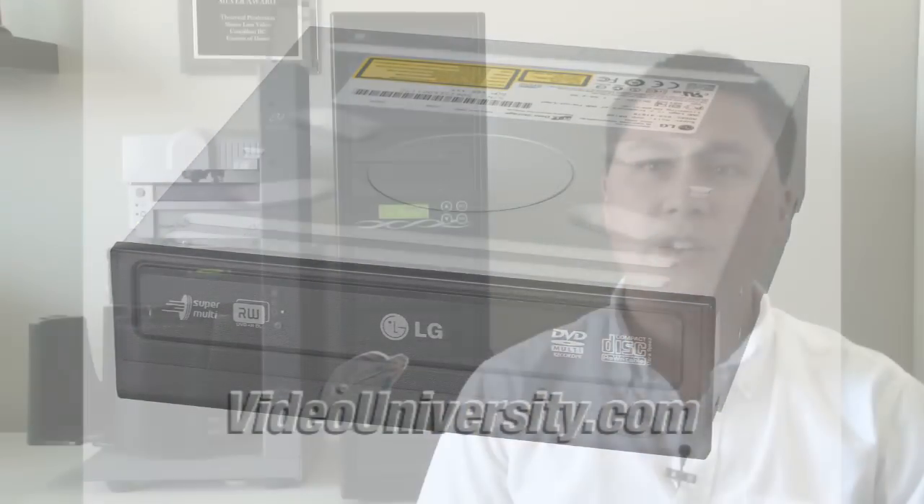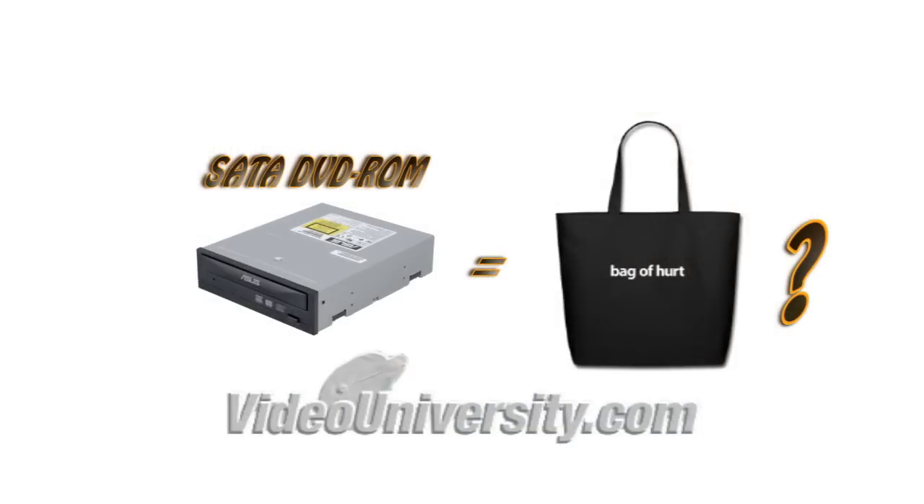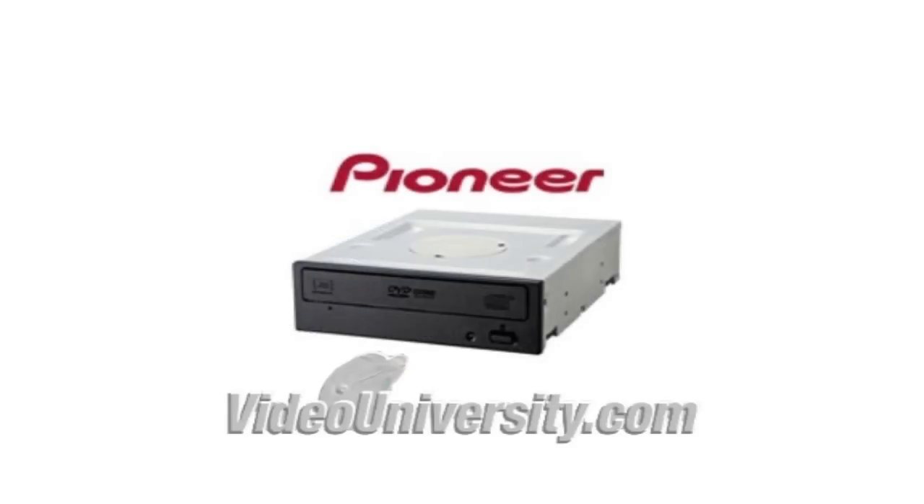So when I bought my Iliathena serial ATA model I wasn't too concerned with the brand of drives I chose, and I ended up getting LG models — they were less expensive but they also didn't work properly in this configuration. A call to Ili tech support revealed that not all drives perform well in their duplicating towers, and a quick check on their compatibility list — which for some strange reason is not available on their own website — confirmed that LG drives don't work with Ili controller cards. I changed to Pioneer burners and the problem went away. For better performance they also encouraged me to use a DVD ROM drive as my source drive, but accomplishing this has been nothing but a bag of hurt, as very few companies still make and distribute DVD ROM drives with a serial ATA connection. I finally located a single ASUS ROM drive that was on their approved list, but it stopped working last week and I have yet to replace it. Regardless, I was able to change my source drive to one of the Pioneer burners and use it to load my disc images before duplicating.